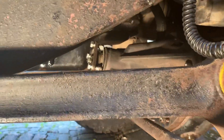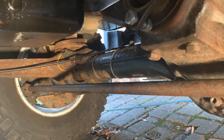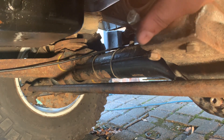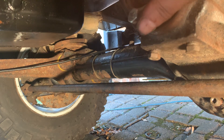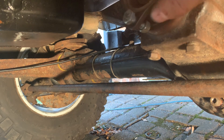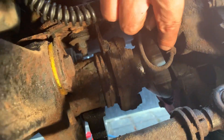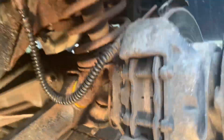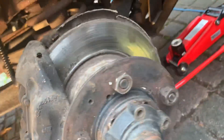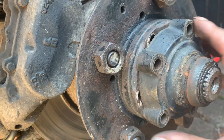I'm just checking where my wear is. There's the final drive flange just above here. I'm just going to turn it and hold that drive on the wheel — look at that, that's the play in the final drive. There's quite a lot of play there, but it could be in the final drive, differential, drive shaft splines, CV joint, or the drive flange splines. I can't tell where it is yet.